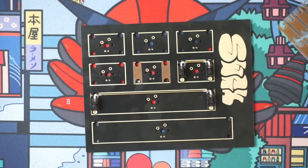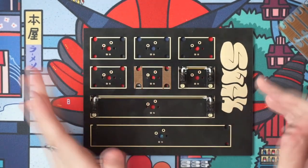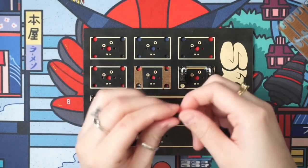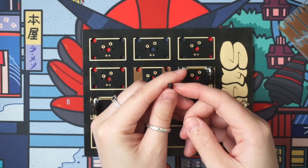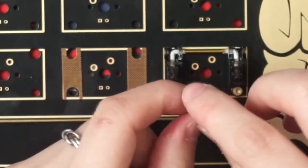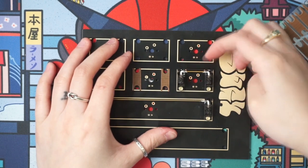The last thing in the kit are the cushions. Owl Stabs have liquid metal wires, which means you don't have to wire balance and you shouldn't be bending them. If you have ticking after lubing and assembling, Owl Labs provides these L-shaped cushions that you can put underneath the wires to reduce any ticking or rattling. The thinner side slides underneath the wire — just push it in.